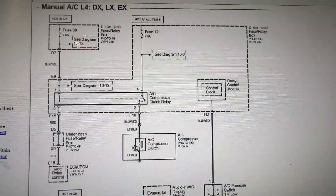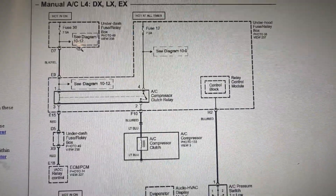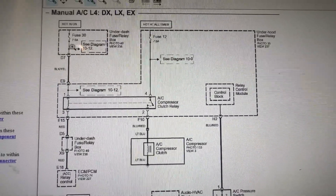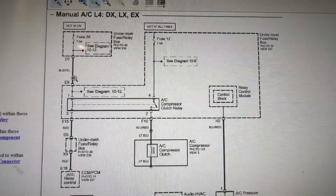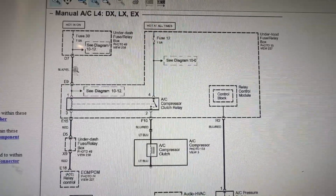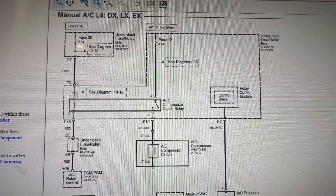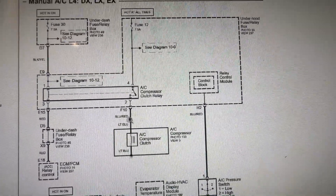It could be jammed — most likely the magnetic coil has shorted itself. There are other fuses like this relay — there's a number 30 fuse, 7.5 amp. This can blow too. This can be a reason of a bad relay, shorted in the circuit. It could be a lot of reasons, but this is the common issue.